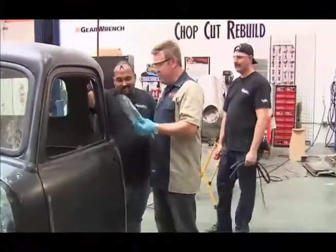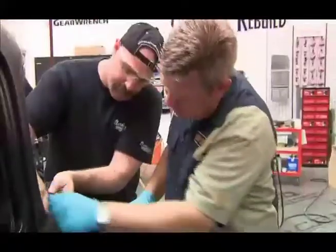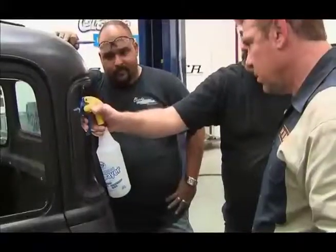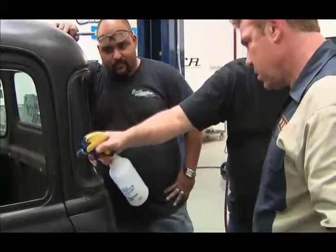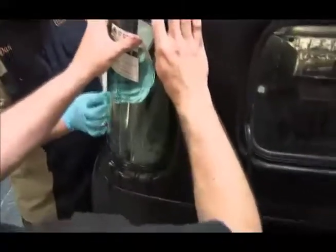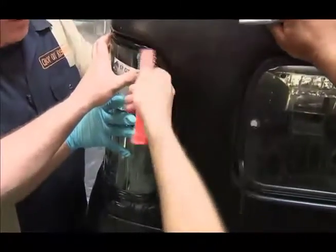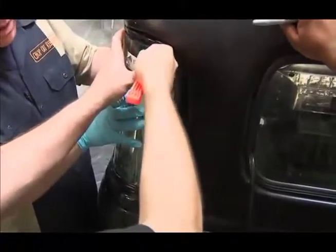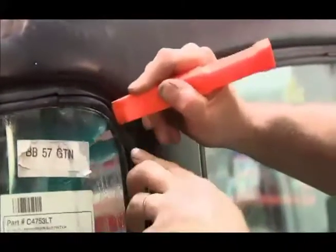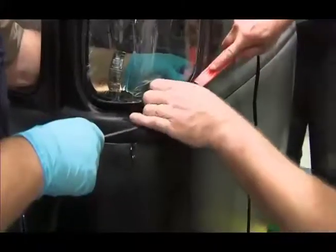So you want me to put this glass in? Yeah — do you have extras? We've got plenty of inventory. We want to make sure that all the glass fits correctly; we don't want to paint this truck and have issues later where the glass doesn't fit. You lay your weatherstrip in first into the cab, then fit your glass, and then put the interlocking strip in. We use a series of wedges — you can use a ground-down screwdriver, anything that's not sharp that you can poke or pry with. You have to use a lot of soapy water, otherwise nothing will go together.